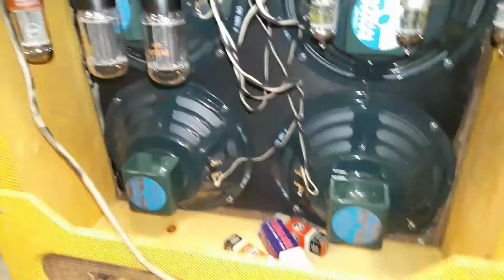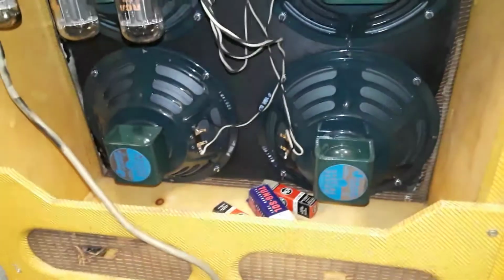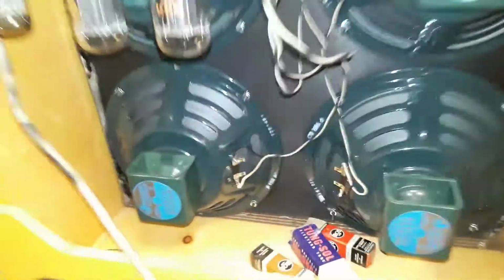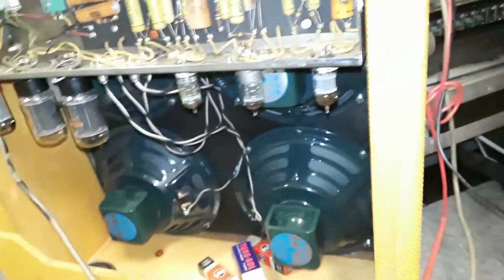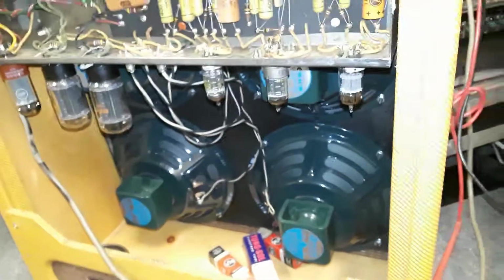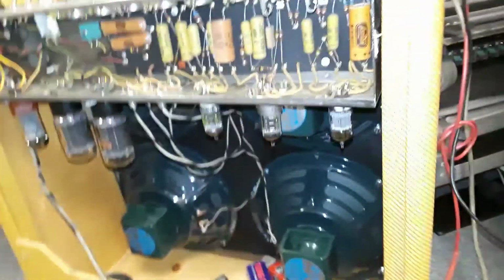What they did is they had taken two of those plastic speakers and put them inside this cabinet, here and here. As a matter of fact, that is why there are holes in this back grill cloth, because that's where the speaker wires went. So they had these speakers hidden, disguised inside this thing. It did have a baffle board in it, but they cut off the lugs where the speakers were, so there were no speaker lugs to bolt speakers to. They cut those off flat so they could mount those speakers inside this cabinet. And then they had these cabinets hanging on the wall.